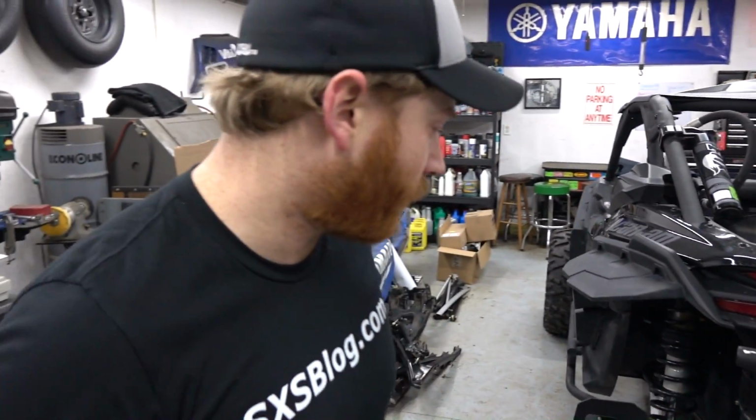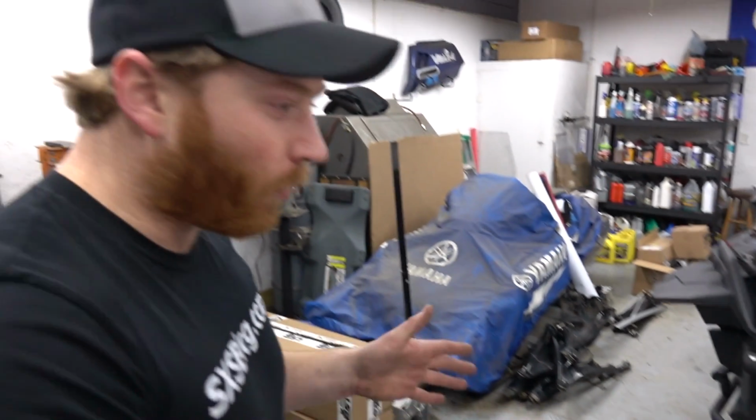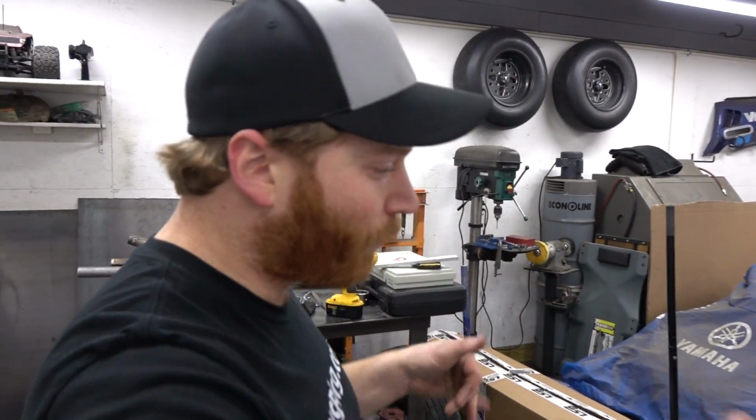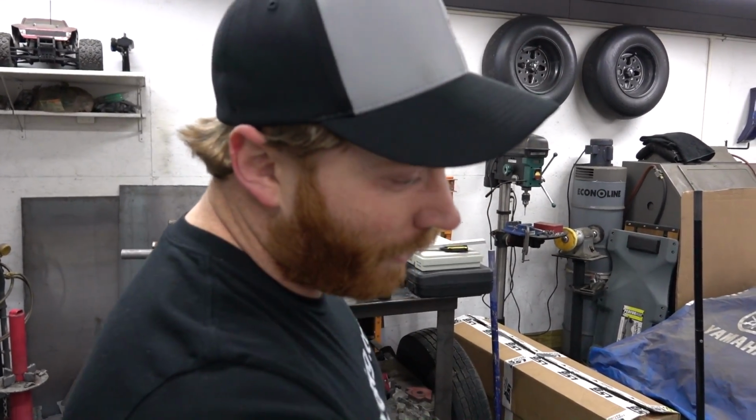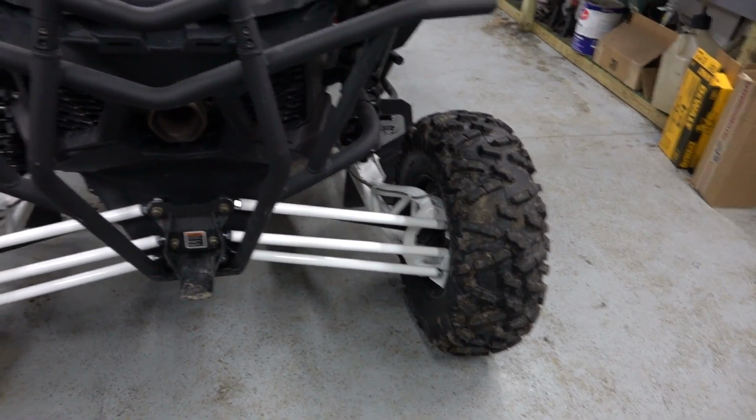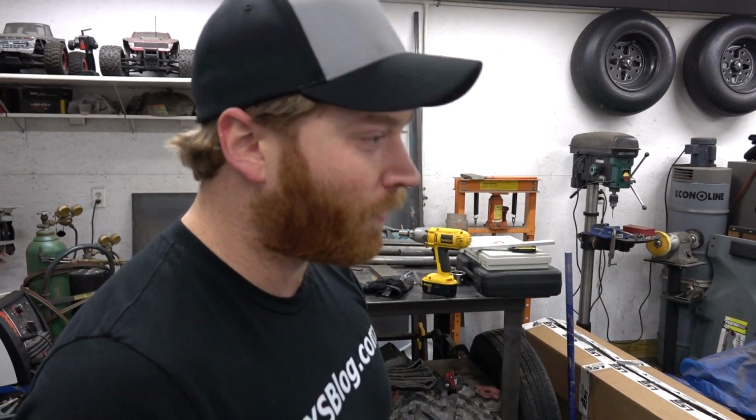So we're going to go on the other side, do the camber on the other side, and then start to do our toe adjustments. So we did that because I think if we adjusted our toe length and got that all squared away, and then we started moving the other radius rods to adjust the camber, we would have thrown our toe off. So we'll do the camber on this side. We'll come in and get the toe locked in, and we'll move to the front.